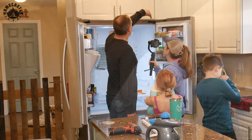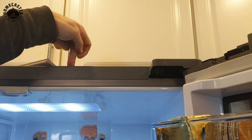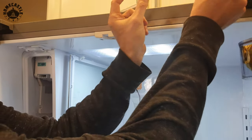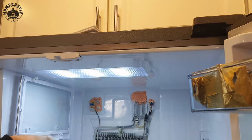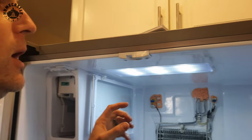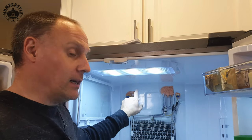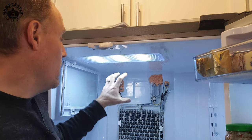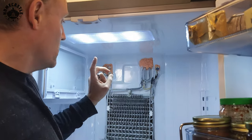This unit has a magnet switch here, and in fact the cover is labeled 'magnet.' To get the fan to run with the doors open you have to override it by sticking two magnets on the door, because normally opening the door stops the circulation fan. To test it, open the door, place two magnets where the arrows indicate, and you'll hear the clicking of the fan blade. As the ice continues to grow it will eventually stop the fan entirely, and then there's no circulation.